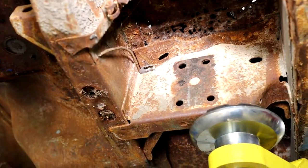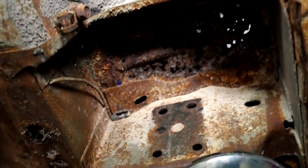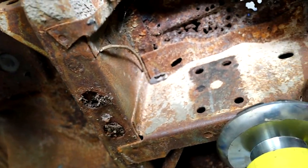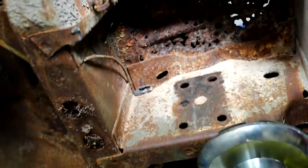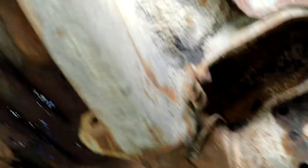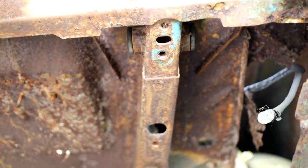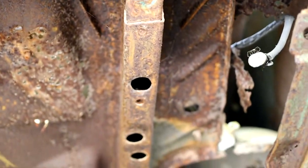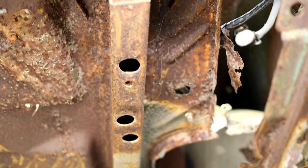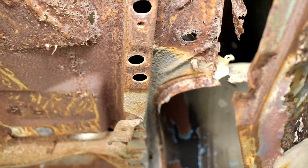In the back it becomes a little bit trickier. This is where the front leaf support goes and there is some good bracing there. As you can see we have a little bit of Swiss cheese that we'll take care of — that's from the rear seat pan. We also have some mounting holes here that will come into play. We'll build a support heading up to the center line, and following the frame all the way back we have our rear leaf shackle mounts. There's a hole there and a hole up here where a bolt would run through. Those are our key areas — the trick is to keep this car aligned so it doesn't move, shift, or get built out of alignment.